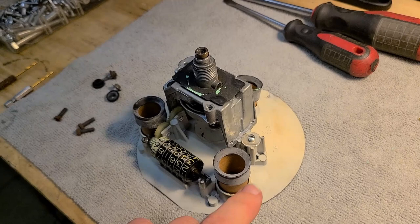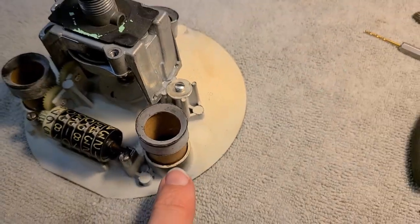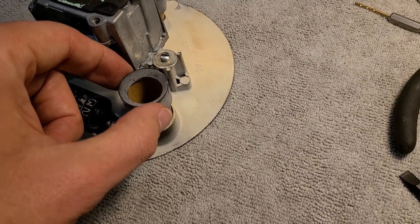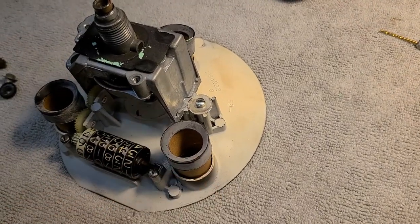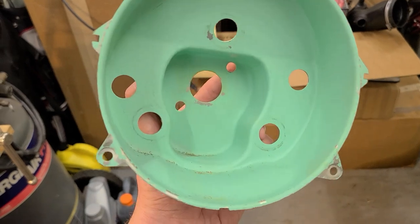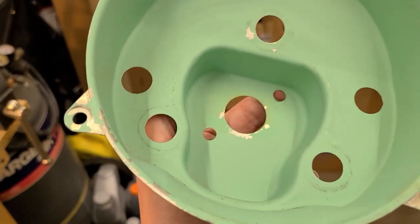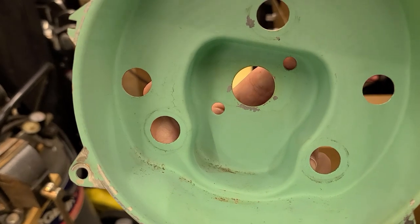Reassembly logic: drop the lenses into the face first before putting the cup on the back, then insert the cardboard tube pieces back with their rubber boots lifted slightly so the cup will press them into correct depth. For the interior cup assembly, the paint is already starting to flake - rather than risk making it worse, just blew out any loose dirt and called it done.